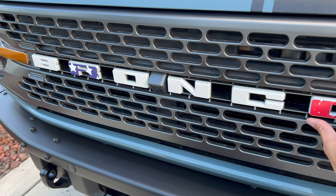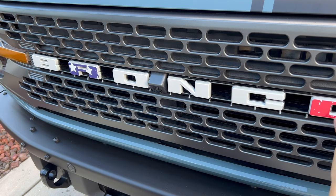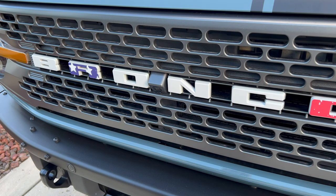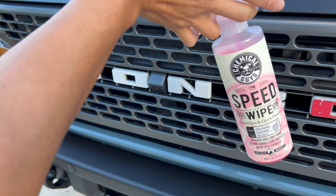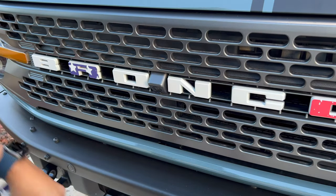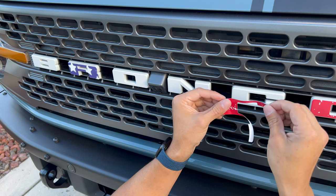Don't let the alignment of the O throw you off — there is a little white strip that goes along the bottom of it because that's how the distressed flag was in this design. Press all these edges down; if they're not sticking that well, apply heat. Use a microfiber cloth and some quick detailer or something that doesn't have any wax in it — you don't want to leave any residue. You can also use isopropyl alcohol wipes, clean it down, let it dry, and then go right into your install. You will get two sets of these, mainly because I know there's a learning curve. This material is different, especially because it has a rock guard over-laminate, so they're a little bit thicker.